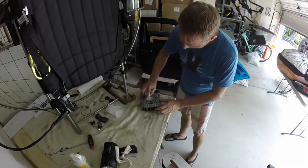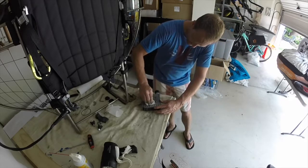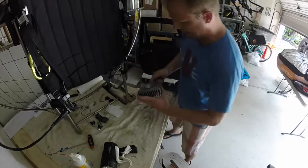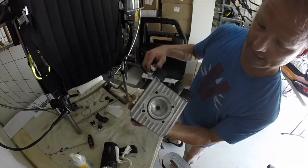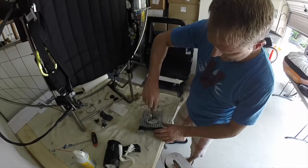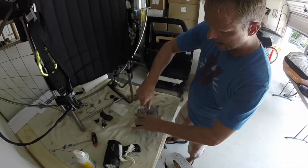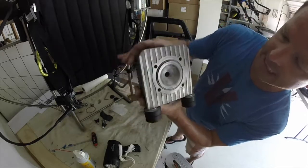I'm just finishing up here, cleaning around the o-ring fitting where I'm going to put this back in. As you can see, I've got it pretty cleaned out and it's looking a lot better than it was. I'm also going through the bottom of this head where the spark plug screws in to make sure all the threads are clean in there, where all that debris was falling. All those threads look good.